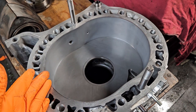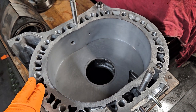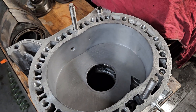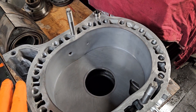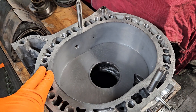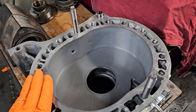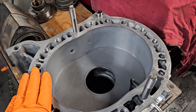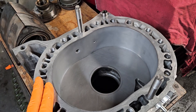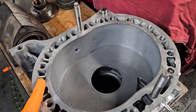Because obviously, if you have to replace a housing, if you've got to replace a rotor when it's balanced, you're in for more cost than if it was just an OEM non-modified block. And really, it's not that bad. So that's what this video is about. We're going to talk a little bit about why this motor came in, how long it had been together, and the fact that it needed replacement rotor housings and lapping, and it will be back on the road again.